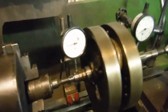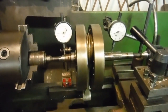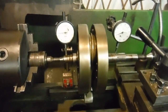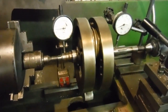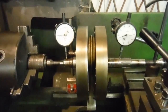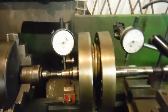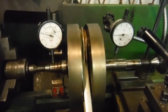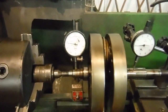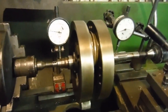But anyway, I'm going to split this crank shortly and go over the big end and change any worn components. I've got a crank pin and I've got a floating bush, etc. So anything that needs changing will be replaced, and then it's my job to put it back together and true it and hopefully get just as respectable run out or non-run out readings as we see here, ready for Jackie to go and do more long distance travels on her Bullet. So no pressure then, Paul.